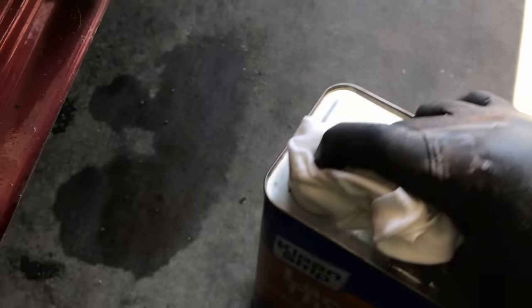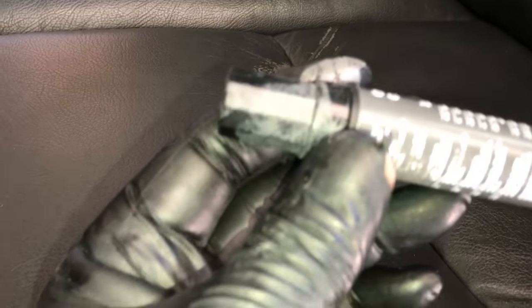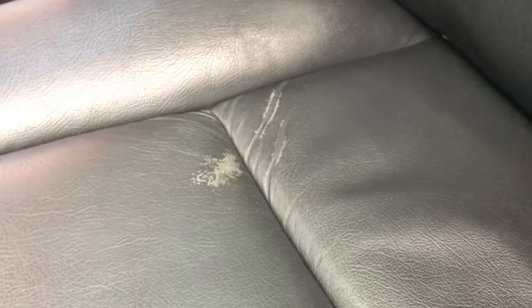We're going to put just a little bit of this on the rag. I've got a little bit of touch-up paint on this to help blend it and bring up a little bit of the seat color with the lacquer thinner. We're not film professionals — just trying to bring you tips on how to save a lot of money making your seats look better. We just take a little bit on the dabber like this, touch it there — it's a pretty close match, all in all. Then we take the lacquer thinner and just go over it — gone.